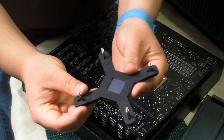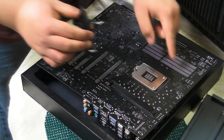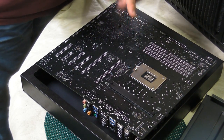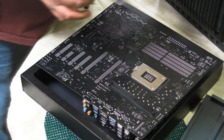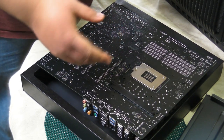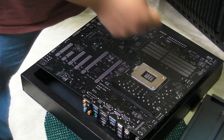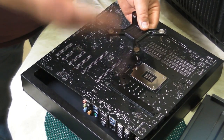We see that we've got the little screws in just the way we want. So now we line it up with these holes. Now you'll notice there are these four holes. In most cases with Intel, as we've said before, it comes with a heat sink when you buy their CPUs retail. They come with a push pin style on the heat sink. And basically, when the motherboard is flipped around, in reverse of what you see right now, you just push it in, push it in, push it in, push it in, you're good. It locks into place. Because of the back plate situation, it's not that simple.